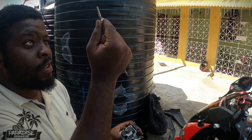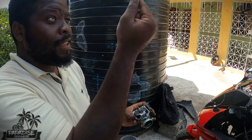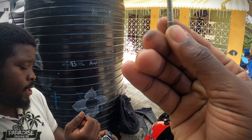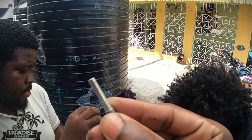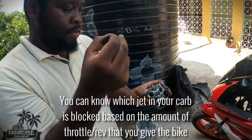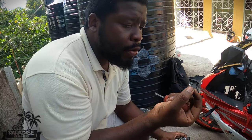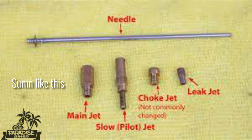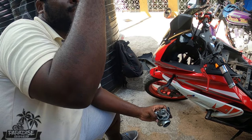It's clogged up, man. You can look through some really small holes on this. You can tell why the bike is baffled. Based on how much rev you give the bike, you can know which jet is the problem — each jet is responsible for a certain amount of rev. The pilot jet handles lower rev, the bigger one handles higher rev.